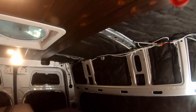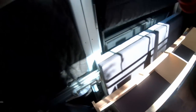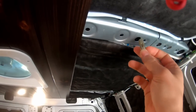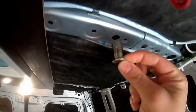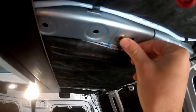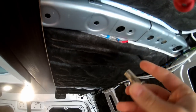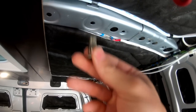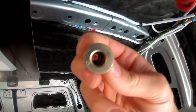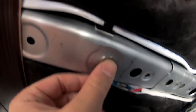A plus nut starts out looking like a small insert — you drill a hole the correct size, put it in, and crank it down. It compresses itself vertically into the drilled hole for a really secure connection to the roof, and you can then screw a 5/16 bolt into it. We're going to start drilling these holes in the roof now. First plus nut hole is done — it slips right in perfectly and we just tighten it down.